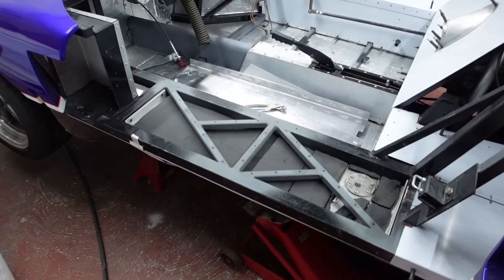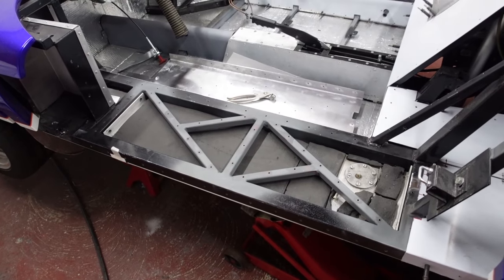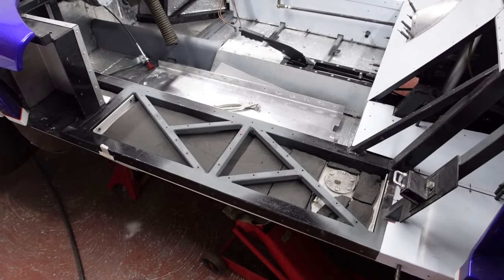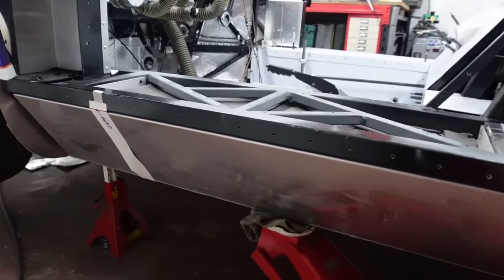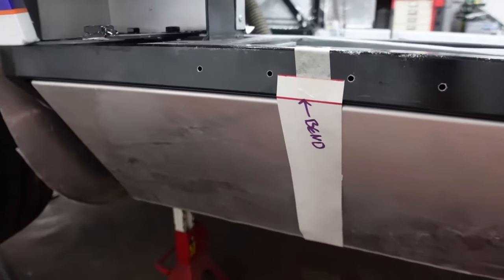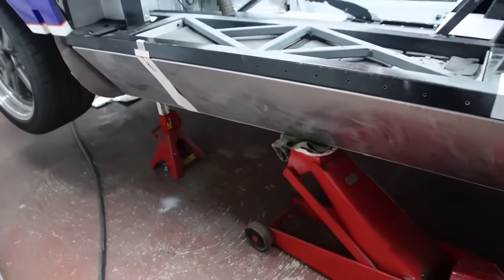The standard fixing for the fuel tanks is a pair of brackets, one at the front and one at the rear of the fuel tank, which is fine, but you can't get to those once the top seal panel is bonded and riveted in place. Now I can't really think of a reason why you'd need to drop the tank very often, but on the times that you do, it becomes quite a problem as you have to strip off the top panel. So what a few people have done is fit the tank with tank straps. I'm going to have three along the length of each tank, simply made up using a cardboard template showing how it will fix in between the run of rivets, run underneath and then fix to the chassis. These will be mounted with two M5 bolts above and below, which should provide more than adequate support for the fuel tank.